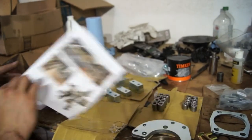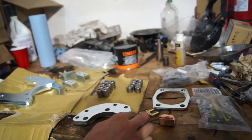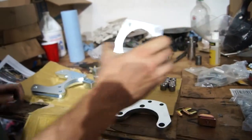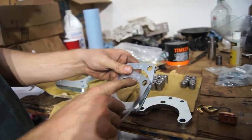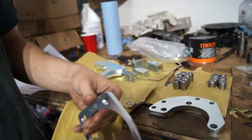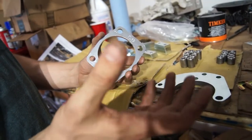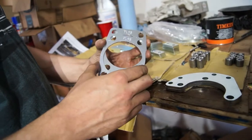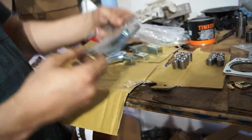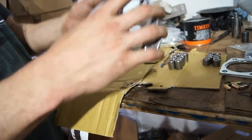What I've noticed is they give you threes, and I'm imagining it's a comprehensive kit for all the years so that it fits on the different Ford nine inch rear ends. These have a part number etched into them — FL9B — which matches up with the flanges on my Ford nine inch from 1973. Those rear ends have different bearing sizes; I have the large bearing, so part B is the one that fits. Additionally, there are mounting brackets, so I went with the B bracket as well, BR9B. There's A through C, so I'm going with the Bs.